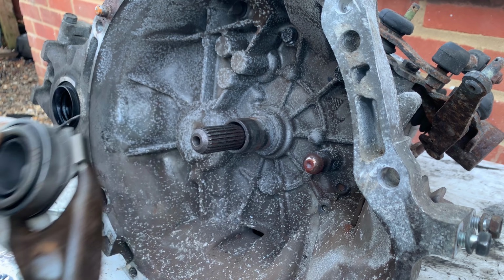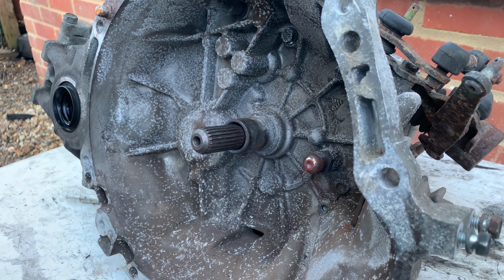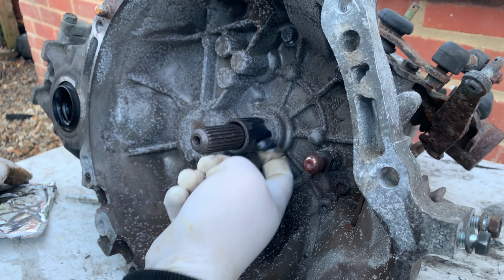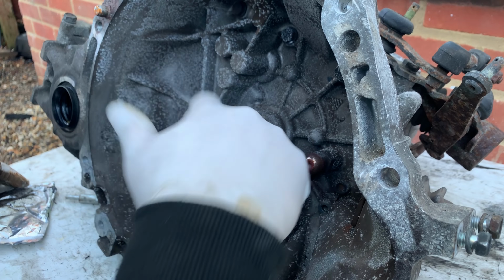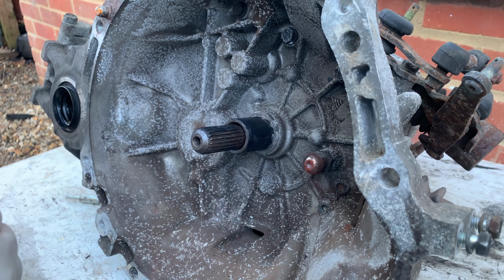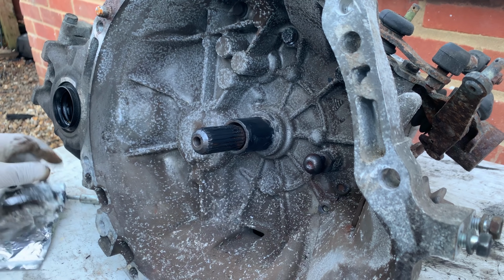Okay guys, so I cleaned the clutch fork as good as I could. It was quite rusted out like this one, and I cleaned them out, and I wasn't supplied a second one of course. So what we're gonna do now, we're gonna just squeeze some grease up where the bearing is gonna go here. Don't need too much, really. A little bit for the shaft. And then the pivot point. You also wanna grease that up nicely. And I'm gonna put a little bit inside here.